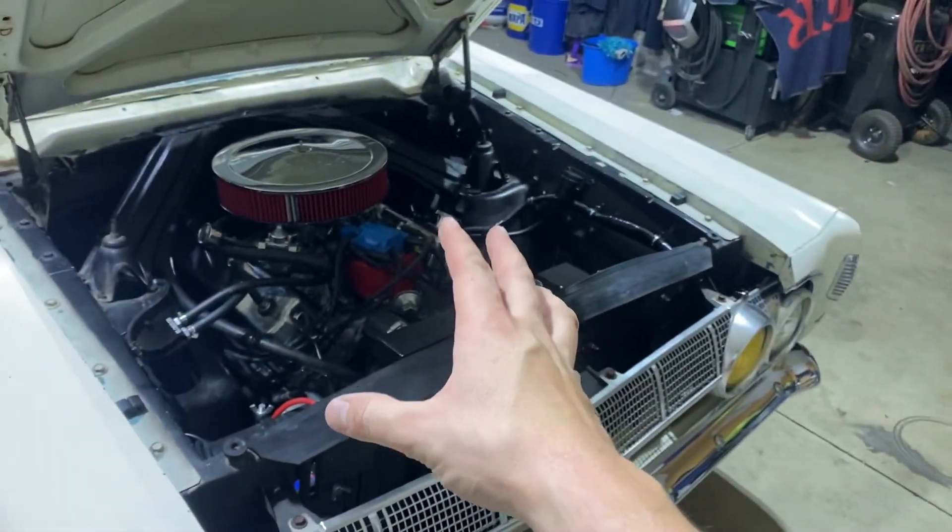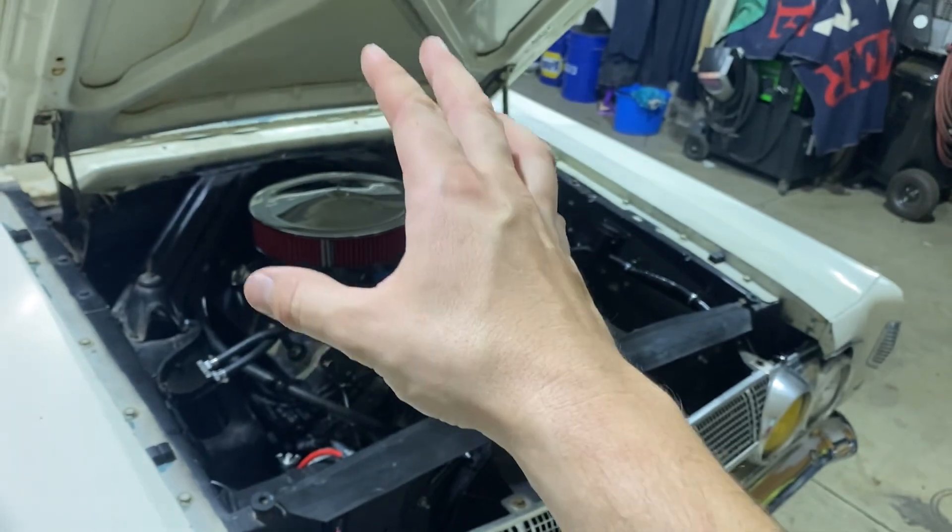It is a little bit later in the season here in Utah so the real test will be next summer, but for right now it is ready for the dyno. The really cool thing about these fans is when you pull off a mechanical fan with no clutch on it — Engine Masters did a video with a 305 Chevy, very similar to this — and between an electric fan and a clutchless mechanical fan they saw a 30 horsepower loss across the board on the engine dyno. For the cost of this harness and fan, if you can pick up 20 wheel horsepower, that's massive.